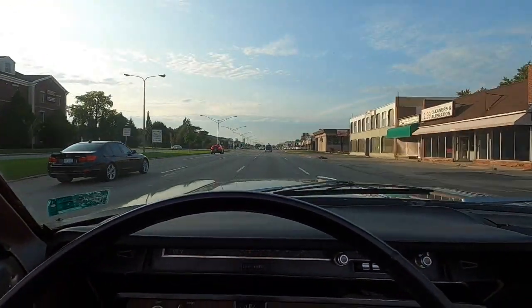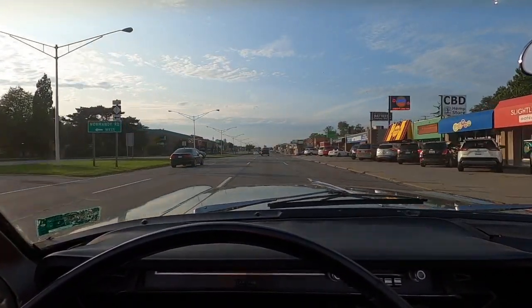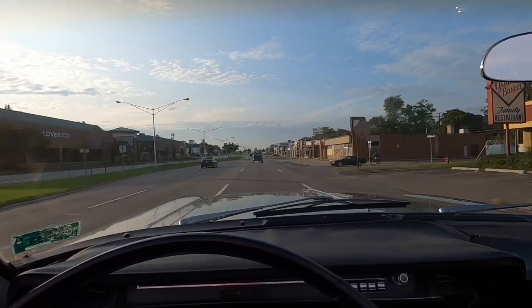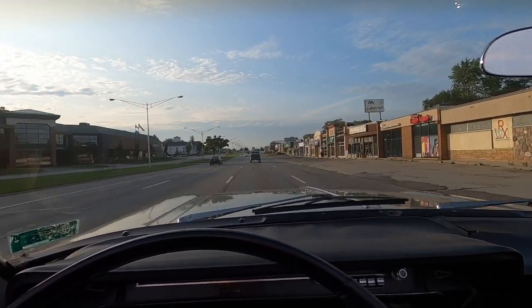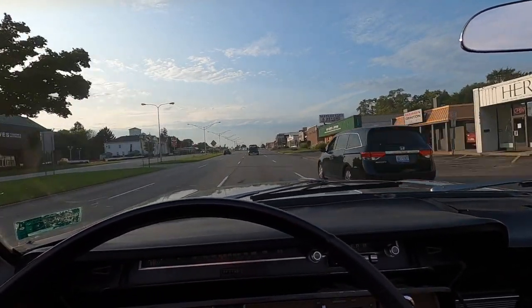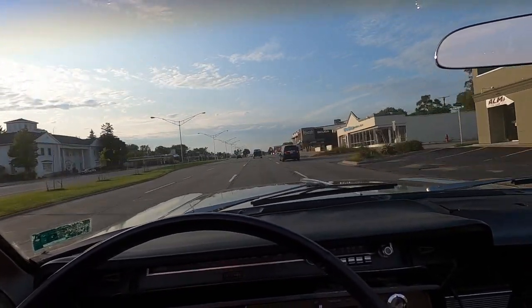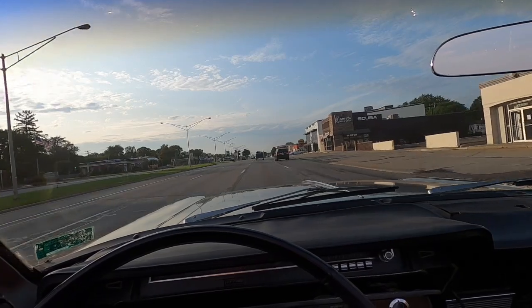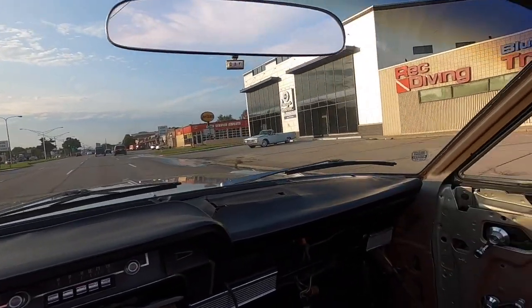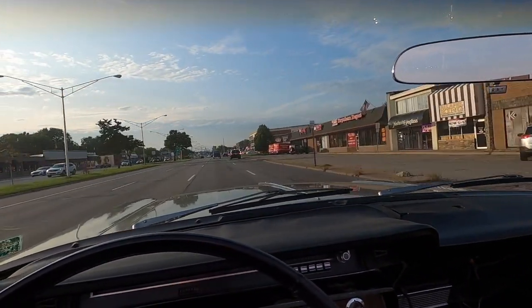It's the 12th of September and there's absolutely lots of cars out cruising. Old Ford pickup ahead of me right now. So yeah, the choke I think is perfect. I did slow the fast idle speed down. 1500 on the second step seemed a little excessive, so I turned it down to about where I like it. Beautiful Lincoln convertible there. Well, nice evening too.